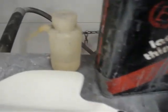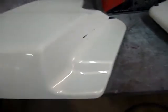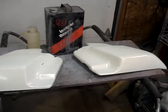Alright, the lacquer thinner out here. Drop towels there. And you can see how well that cleans up. Right here's where those pads were. You can see no gouge marks or anything from my little putty knife that I use, a scraper. Come off real nice. Just lacquer thinner. I dip it from the little squirt bottle there that we like to use. So there you are, all cleaned up. Now we're ready to continue sanding. So I'll bring you back when we get these all sanded up.